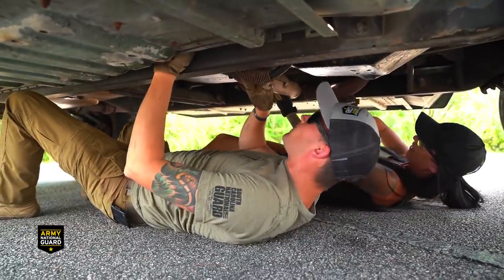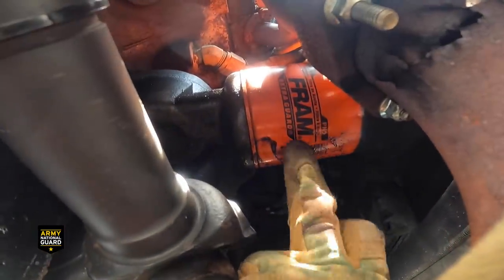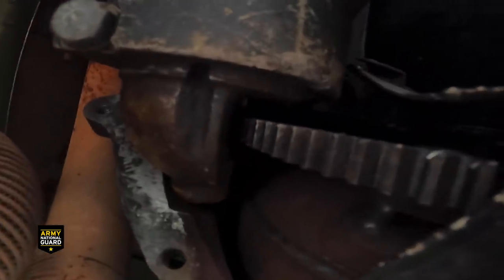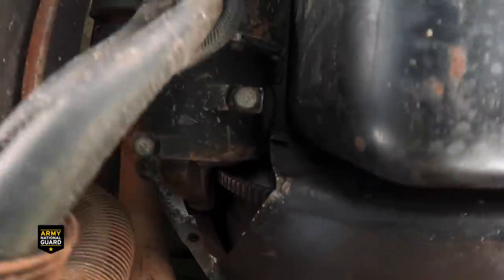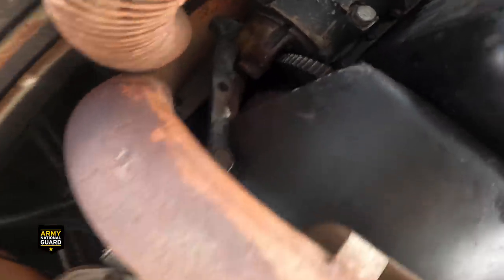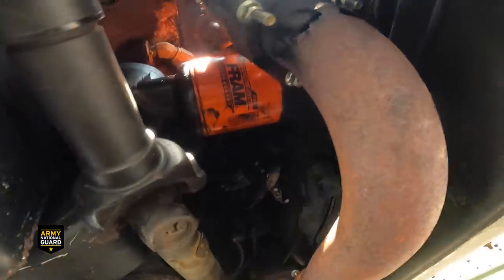Working down the middle of the vehicle - it's pretty rusty. Come look this way: there's a big chunk of the bell housing missing. On this side you can see what it's supposed to look like - so you'll need a new bell housing. And up here on the exhaust, you've got a pretty major exhaust leak where it's rusted all the way through. That's not ideal.